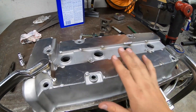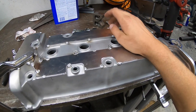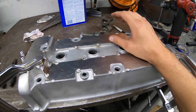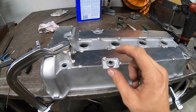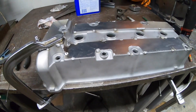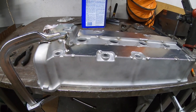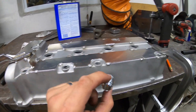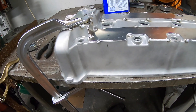The next step is obviously to get it welded up, but we also have to add an oil fill - I just ordered a low profile bung with a cap. We also need to modify the dipstick handle: just chop it in half and put a little pull ring on it. And we have to add a catch can for the valve cover breather - we're just gonna run two dash-ten fittings right here and here.